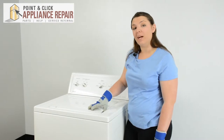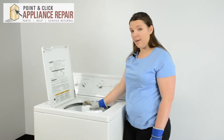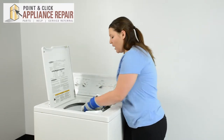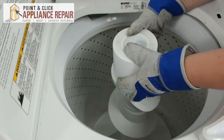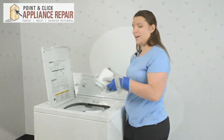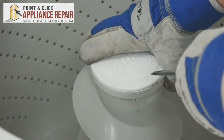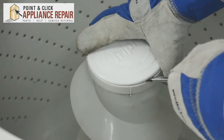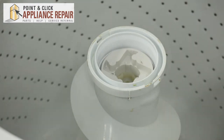We'll start by opening up the top of the washer. First thing we need to do is remove the softener dispenser. Some models just lift right up. In this model, there's a locking ring — lift up on that locking ring and you'll be able to lift up and it'll pop right off. This model has a cap; we need to remove it with a flathead screwdriver. Just pry it up. It'll give us access to our agitator cam.